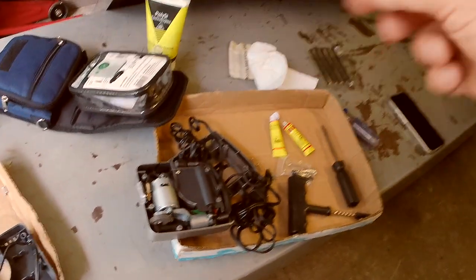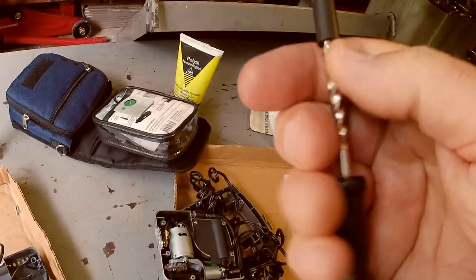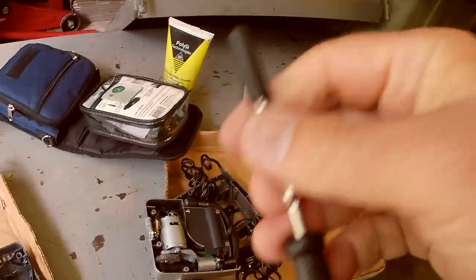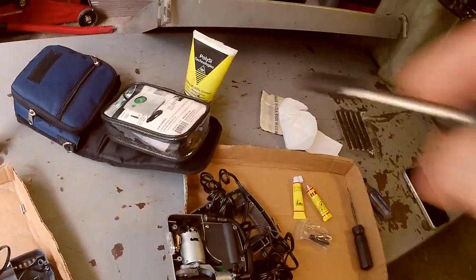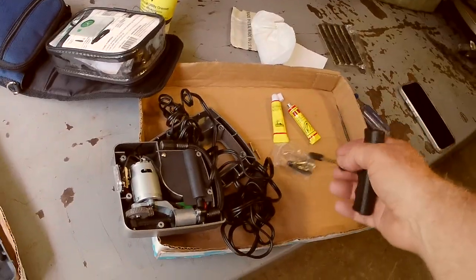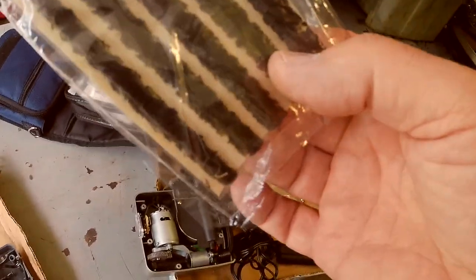You want to put that glue on once you get the nail out. This is the reamer. I have this rubber on here so it doesn't stab anything. But you want to put the glue on here and ream the hole to make it the correct size to have an interference fit against the plug, which is going to be doubled up.